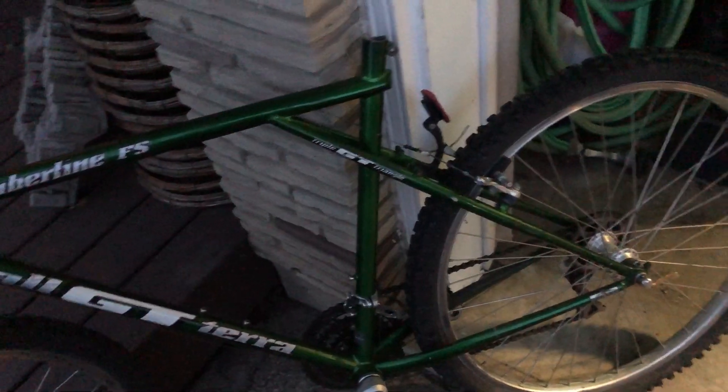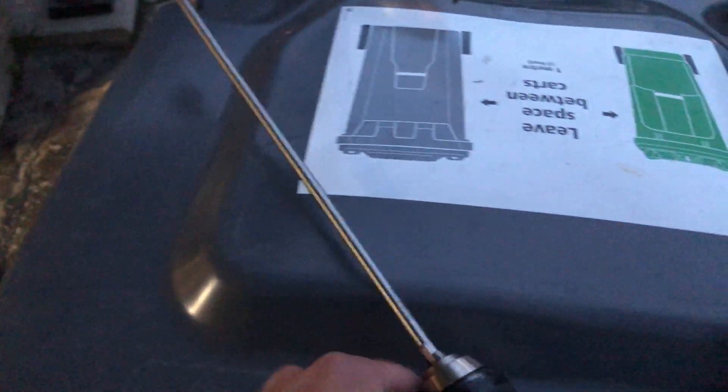My solution — with about four inches of aluminum seat post left — was I went to the store and bought a one-inch spade bit that's about 16 inches long. That allowed me to get right down to where the rest of the seat post was, and I was able to drill through pretty easily. I don't know if the aluminum was just easy to cut through with a brand new bit, or if the gallium actually did make it a little more brittle, but it took about 10 minutes of drilling. We can look down here now.